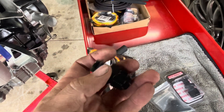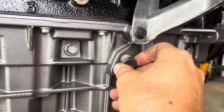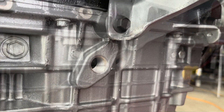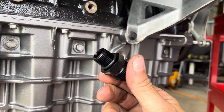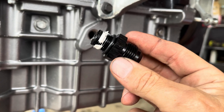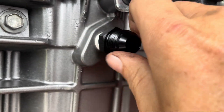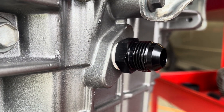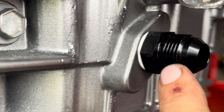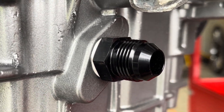The rain has finally subsided so you might actually be able to hear me. I'll get the bung out of the sump — that was just in there to keep everything covered. I've got the fitting here ready to go with the O-ring on it, so I'll put a little bit of thread sealant on the thread and get that in. Got it in as far as I can by hand, so now I'll grab an adjustable spanner and tighten it up. All tightened up — pretty tight, and with the thread sealant in there that should be okay.